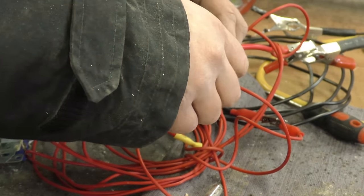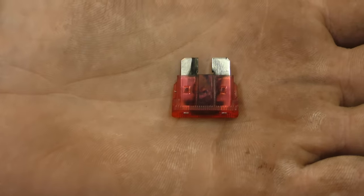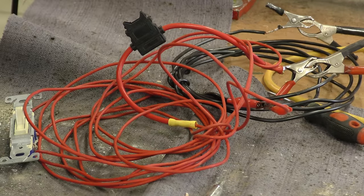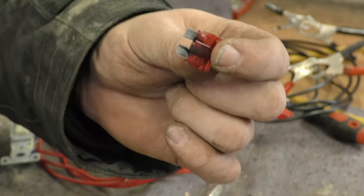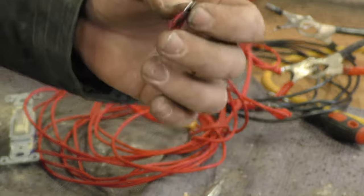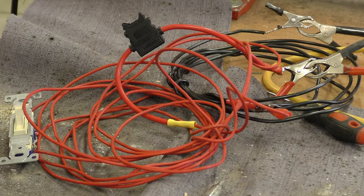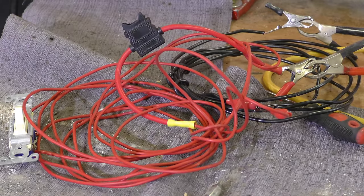The question is: did the fuse fail? It appears to have failed. The fuse has definitely failed — in fact it looks like it blew the entire interior of the fuse out. Everybody seems to think this is incredibly dangerous. Now I'm not saying I would necessarily agree with doing this — a 12-volt fuse in a 120-volt system is not necessarily the greatest idea — but it worked. And what you folks may have noticed, you probably saw the lights go out.